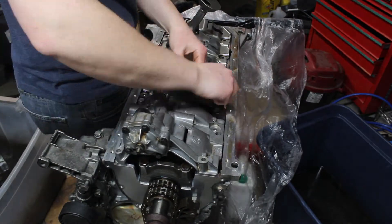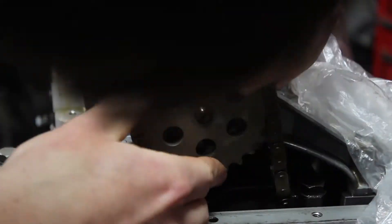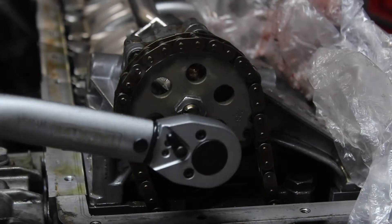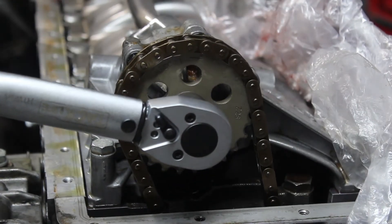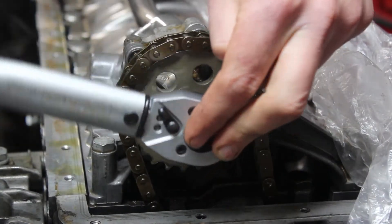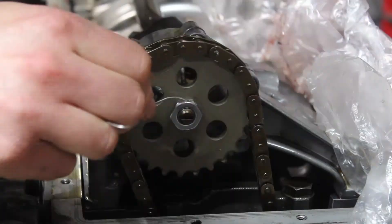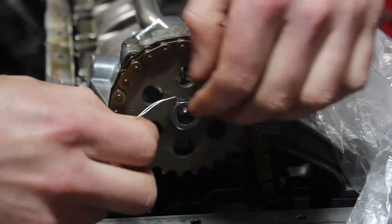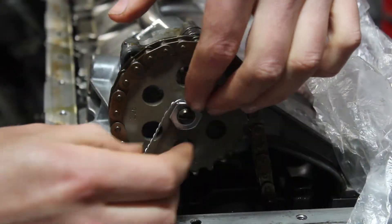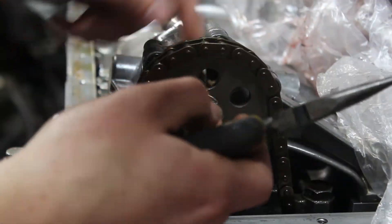Now the oil pump and pickup can be installed on the bottom end. The oil pump sprocket goes on the spline shaft, and the reverse-threaded nut gets installed. This has been known to back off, as we discovered when taking my engine apart, so it needs to be torqued properly and safety-wired. Since I knew the rolling torque of the engine was about the same as the torque spec of the nut, I simply turned the engine over to torque it, since my torque wrench doesn't work in reverse. I did the best amateur safety wiring I could, and only had to redo it once after breaking it. This prevents the nut from backing off by spinning to the right, since it's a reverse-threaded nut. Welding the nut is also an option, but I'd rather not have to grind inside the engine to get it off.